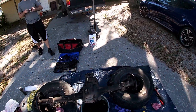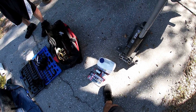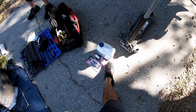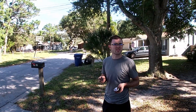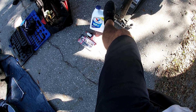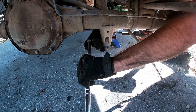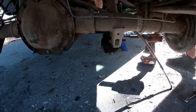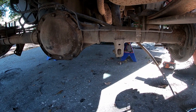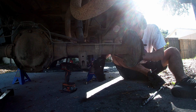The diff is drained. We took a trip to the auto parts store for three essential ingredients of a diff job: a seal, friction-enhancing fluid for the clutch discs in the limited slip diff — which apparently also helps with the chatter problem these are known for — and then some 80W-90 gear oil. We've gotten smart this time and we're taking the shocks out first. Last time we didn't and it was a huge mistake — the whole rear end was just twisting itself freely. Very annoying.